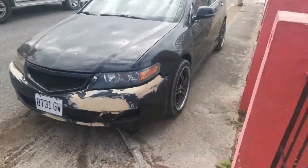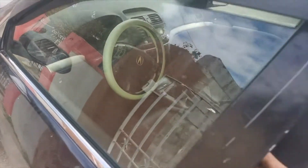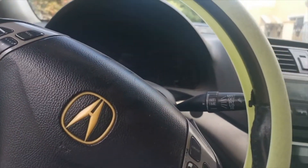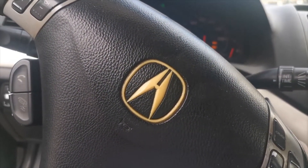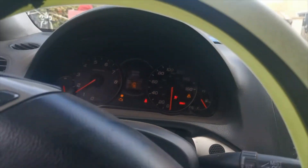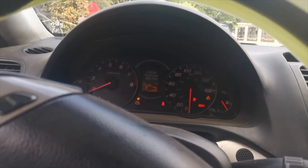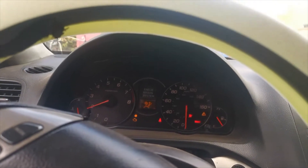Welcome. So yesterday I was driving and I started to feel the car sputter — like a buck-buck — unusual. I'm not sure what caused it. Anyway, it starts fine, but then when I try to rev it, it couldn't go over 3000 RPM, so it went into limp mode.